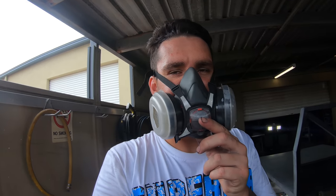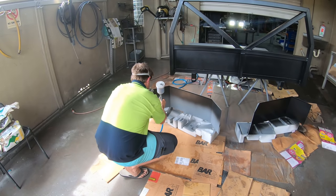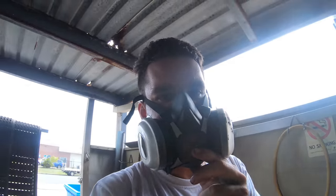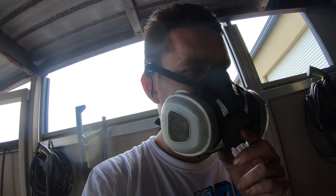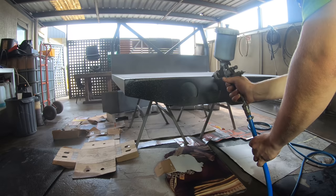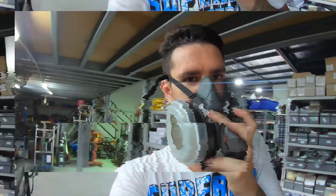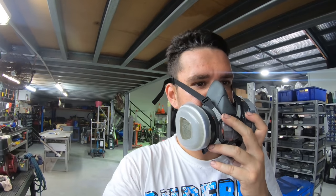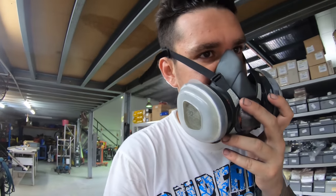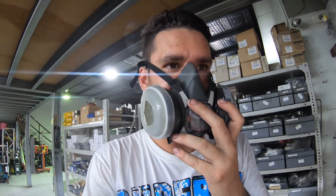So I'm probably not telling you guys anything, but it's really important that when me and Ryan paint, we try and keep the same distance away, which I think we're doing pretty well, because distance actually affects texture with Raptor. Good point Ryan just had is that your speed obviously needs to be very consistent, and his needs to be consistent with mine because we're both painting it. I'm so keen to see the final product. We'll see you guys when the first coat's done.